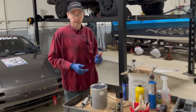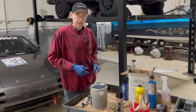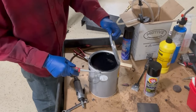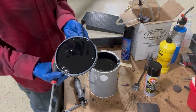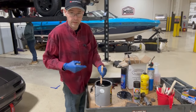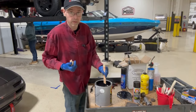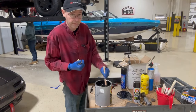Fluid Film was kind enough to send me this stuff. It's not a sponsorship. I don't have a code at this time — if I do before the video comes out, I'll let you know. This is Fluid Film Black. I'm interested to see what the consistency is. This stuff is lanolin-based and it does self-heal and wicks back together if you have any problems. You can also take this stuff off with chemicals and cleaners rather than rubberized undercoating or petroleum-based, which doesn't want to come off. So this has some advantages if you have to do vehicle repairs.